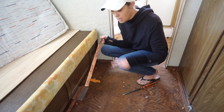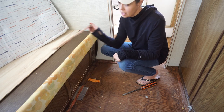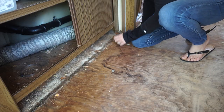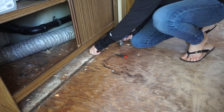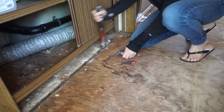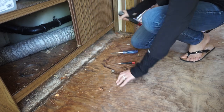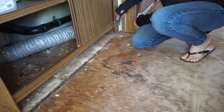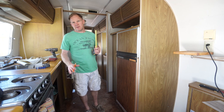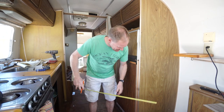Be careful when you pull this stuff up. Obviously it has nails on the top, but it also has nails on the bottom, so make sure you properly dispose of it quickly. Once we have the tack strip out, we need to make sure that everything else is removed from the floor — some nails sticking up, some staples. We're going to take a hammer and a flat head screwdriver, clean out anything sticking up out of this floor, then vacuum it to make sure we didn't miss anything. The demo crew has gotten all the carpet out and all the staples and the tack strip.